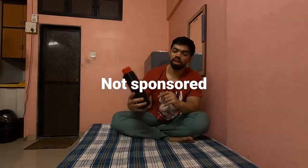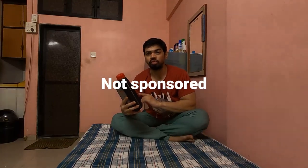The first thing replaced was the engine oil. I went with Castrol Power Ultimate 10W-50, as recommended in the Dominar 400 manual. Always check which oil grade is recommended for your bike in the manual. This is a fully synthetic oil. I bought two one-liter cans since a 1.5-liter can wasn't available.